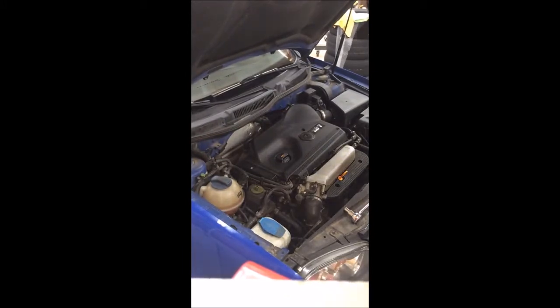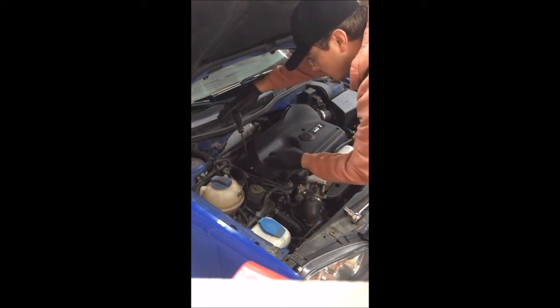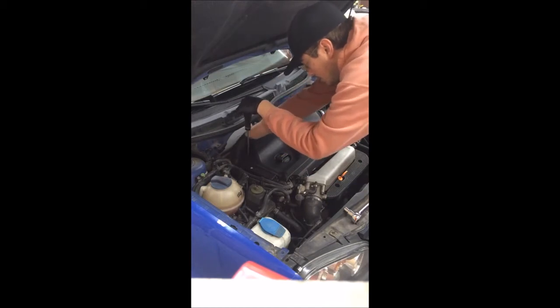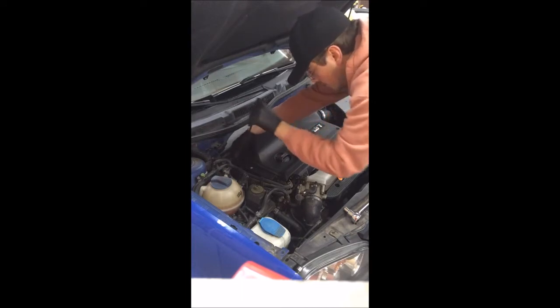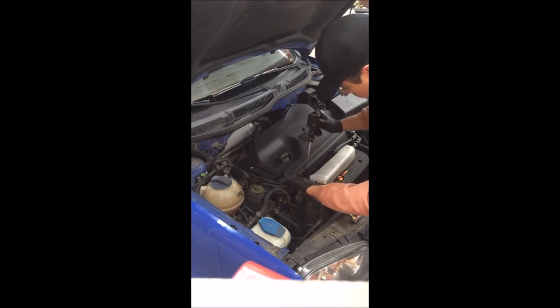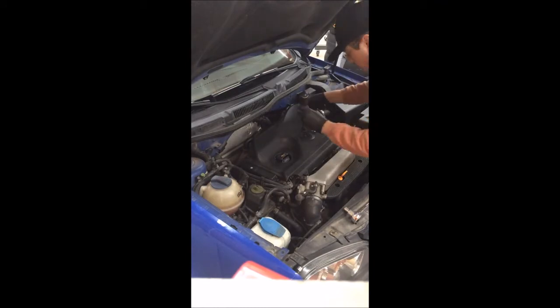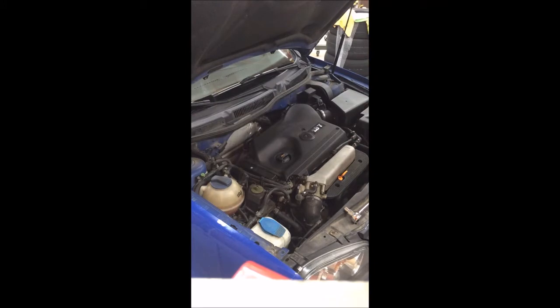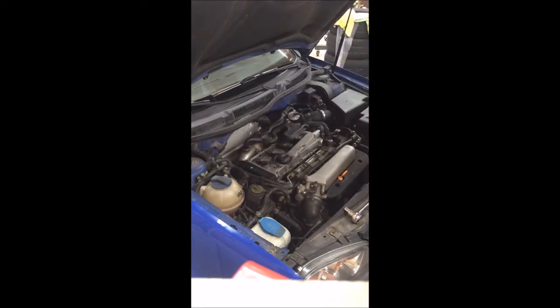Okay, so let's start on the engine cover here. We're going to start back here, and my little tip is to get one hand up under the lip and slightly pull up as you are unscrewing. Like a quarter of a turn, and they release. Same thing here, get your hand up under here, start unscrewing, and it pops off. There's another one here, and mine is missing one there, like I said. So this should simply lift up, and we will set this aside.